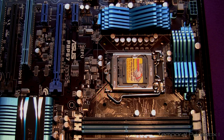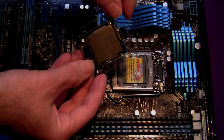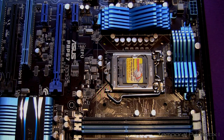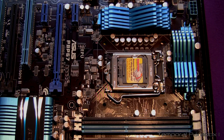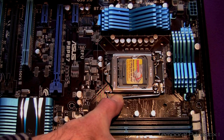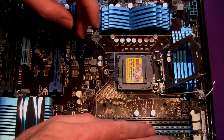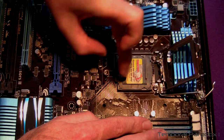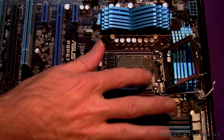The very first step is to install the CPU. There it is — there's our i7-2600K. This is the first time I've built a computer and I must say, one of the things that's quite trippy is just how much smaller everything appears in real life compared to watching people's videos on YouTube. So I'm going to put some pressure down on this bar, and as I'm putting pressure down I'm sort of moving it to the side so it comes off like that. It flips back like there. Then putting one hand down here just to stabilise the board and putting some fairly decent pressure, squeezing together on these black sections here, because these can be a bit tricky. And yep, there it goes. Be careful not to touch any of that — it's very delicate.